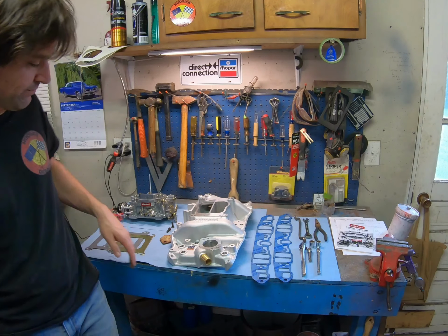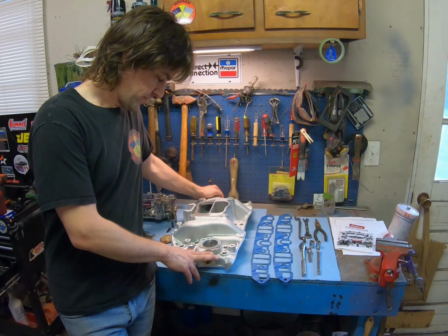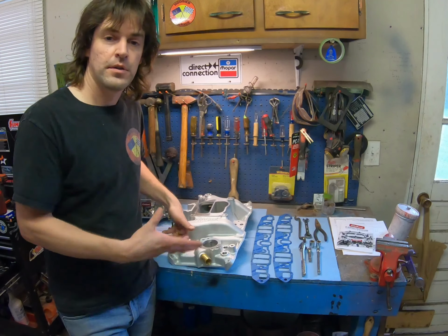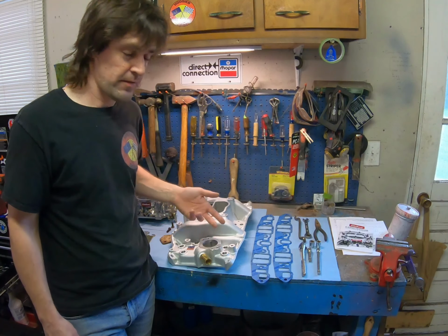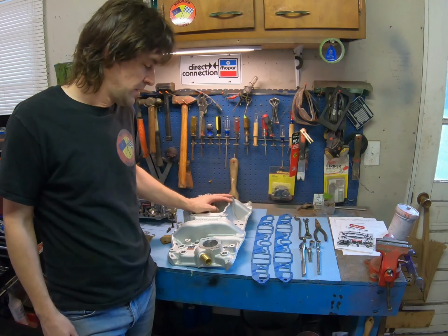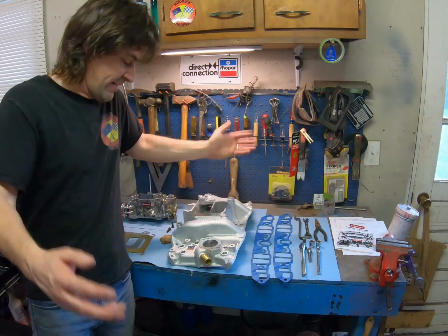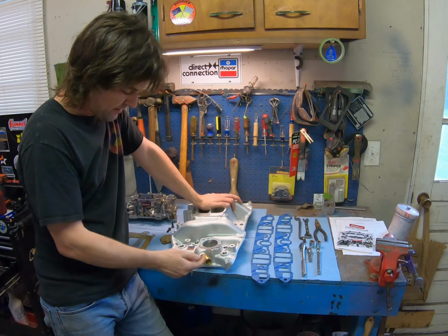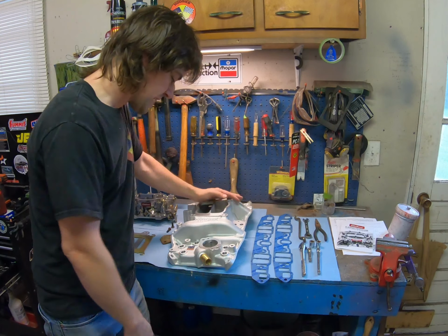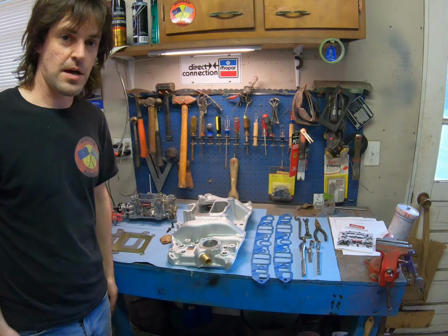One of my big peeves about Edelbrock here: brand new intake in the box, and you have all these extra holes for whether it be sensors or whatever it is you're using. One of them is for your nipple for the heater hose system, but the rest of them you would plug off if you're keeping a basic setup. Well, they didn't give you any plugs, so you got to order the plugs separately, and it's usually like another $15. And they have the big Allen head, and you screw them in with a little bit of putty on them. But they didn't give us any of them, nothing. They gave us this, which was great, so I got some tape dope on it and screwed them in. So we're good there. We'll just have to get some plugs, and of course that's going to slow you down, but we'll live. And let's get started tearing the top of this thing off.